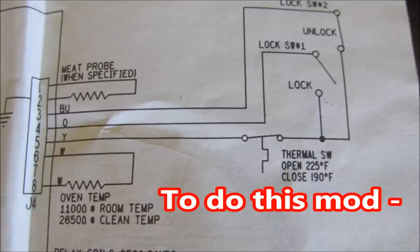Now the door switch that controls the light in that oven is on that same little interlock circuit, so you've got to bypass the light switch to make it think the oven door is shut all the time. So if you do this mod, you're going to have to jump out your light switch — when you open your oven door the light won't come on. The light will still come on if you push the light button on the control panel, because it's a separate sub-circuit. The three wires on the right are the ones that go down to the switch.